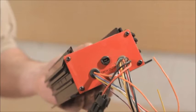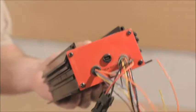On the subject of spark boxes or CD boxes, only use one if using forced induction and only in high boost applications, and even then only if necessary. The vast majority of you will not need one and will get absolutely no benefit from using one. If it's already installed in the car, take it out. If you're running high boost levels and you experience spark blowout, then install one.